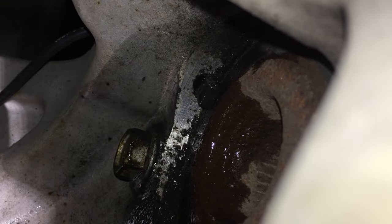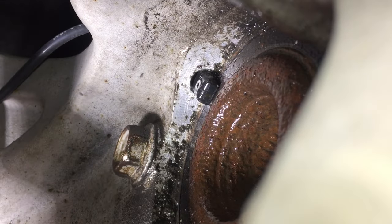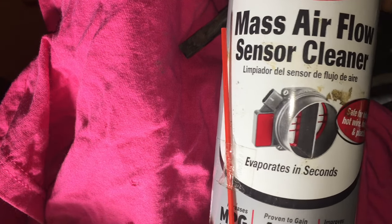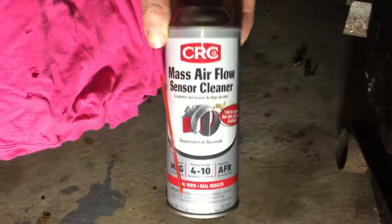A couple years ago when the warning lights were on, I jacked up the car and sprayed the encoder rings down with cleaner, then wiped it down as I rotated the wheel. The little black piece is the sensor. Note that brake cleaner is an easy go-to, but brake cleaner is bad for rubber and plastic. I used mass airflow sensor cleaner because I had it laying around — it's safe for electronics and plastic, which seemed like a better choice. I think it's rare that this will solve the issue, but it worked for me once.